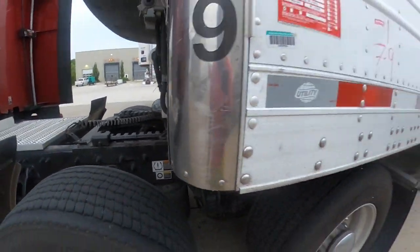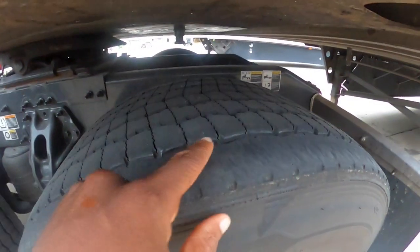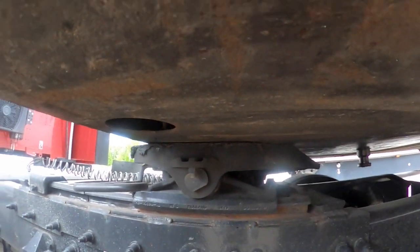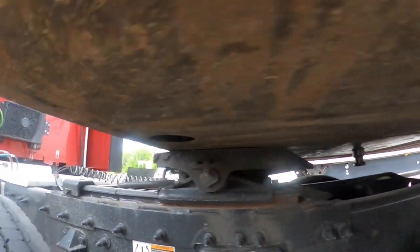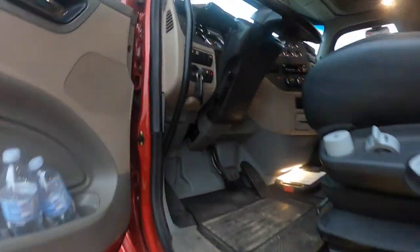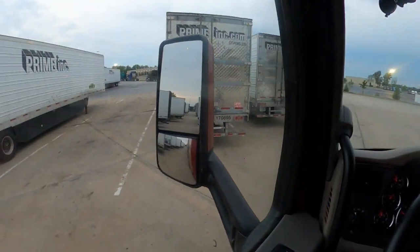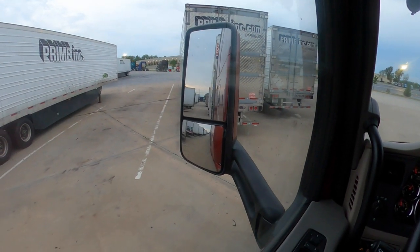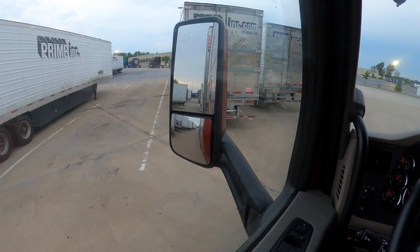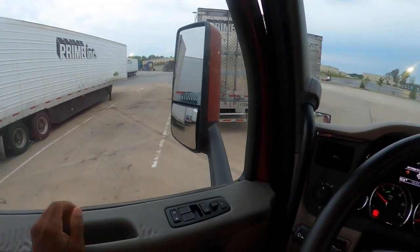Here's where you should feel it. If you need to get out and look, get out and look and make sure there is no gap between your skid plate and the actual trailer. After that, get back in the truck and push it back. I'm just putting it in reverse, going straight back. I don't bang it — I just try to touch it. You've got to touch it a little quicker than half a mile an hour, but you don't have to do three miles an hour. It was still a little forceful — but not too forceful.